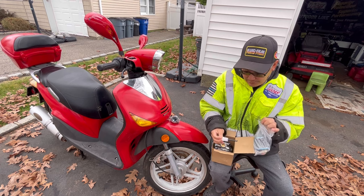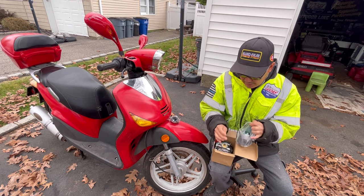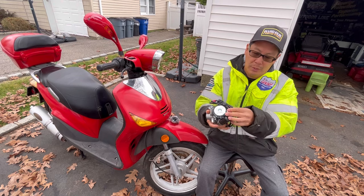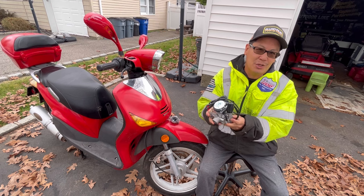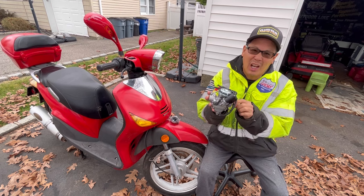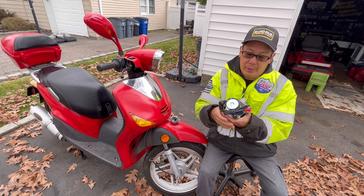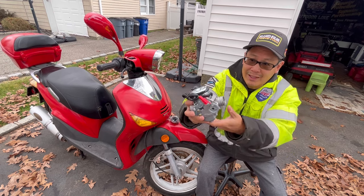Here's another fuel filter with a little gas line, and here's the carburetor. This carburetor has all kinds of vacuum lines, and from what I was reading, you can delete all these vacuum lines because they're just for the EGR — emissions and stuff. But many times if you have a small leak in the vacuum line or it's not connected right, it's not going to run right. This is a brand new carburetor and it looks identical to the one I have.